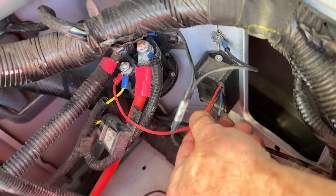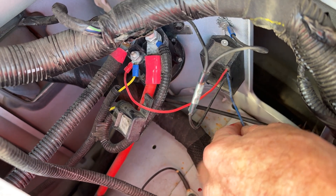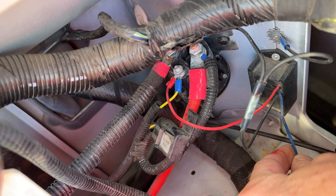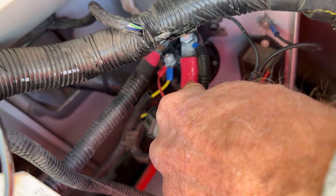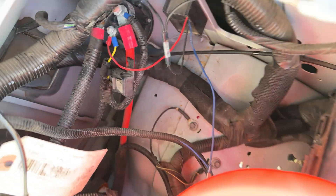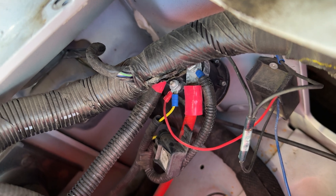You can see that this old relay has three wires hooked up to it. We've got a positive and a negative — that's the black and the red — and then this blue comes from the ignition. The new relay is going to have four wires. That fourth wire is going to be going to the coach battery. So I need to find out which one of these two wires goes to the coach and which one is the chassis battery. I'm going to do a continuity test to figure out which wire that actually is. I've got one side of my continuity tester hooked up to the battery and I'm just going to touch both of these two terminals to figure out which one is going to the battery.